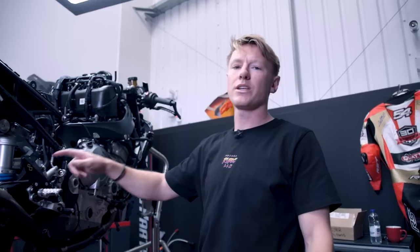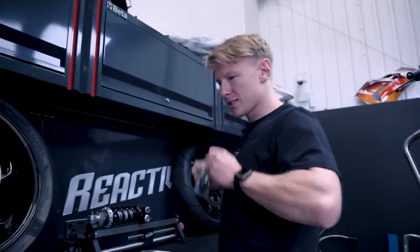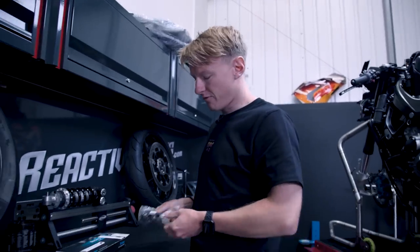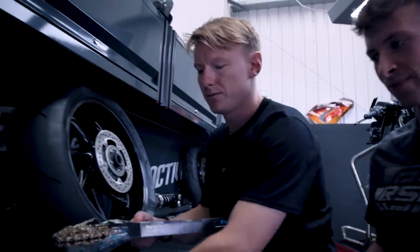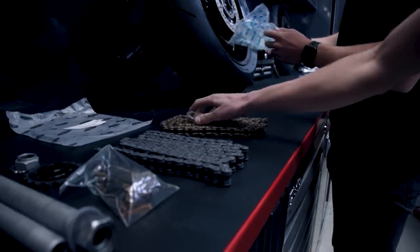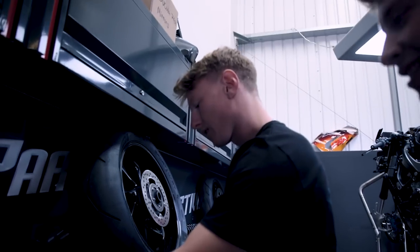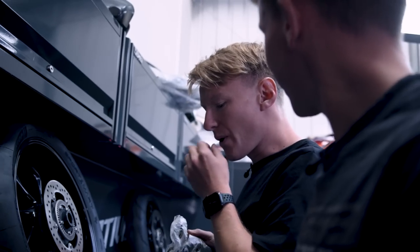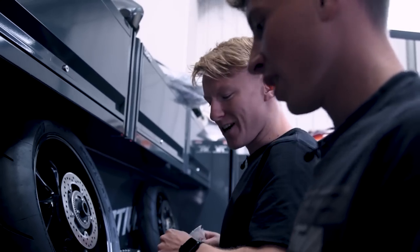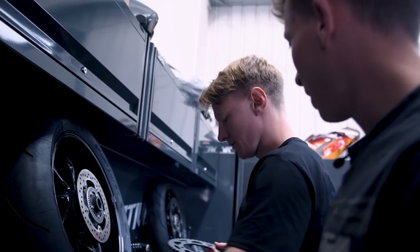We're working our way to the back of the bike. The next big job is the chain and sprockets. We're going to unbox the chain and sprockets now. We've got a PBR front sprocket and a 520 chain conversion. Front sprocket — we've lost that heavy 525. Let's compare. This looks like a race bike now. Rear sprocket — 45 tooth. It's going to be interesting to weigh these. Let's weigh the standard chain and sprockets versus the 520 conversion with the PBR front and rear sprockets.